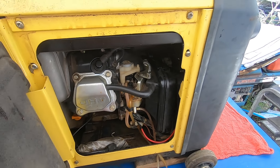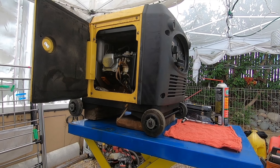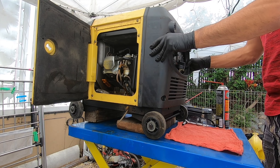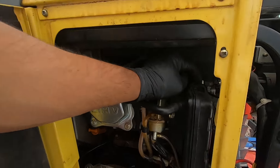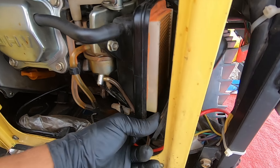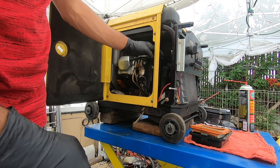What I'm gonna show you guys today is how to remove this carburetor. First thing you want to do is loosen up the bolts — in this case the handle and the bolts all the way around — so that you can pull this lid. Next we're gonna pull the air box, just pop it like that and it should come off the bottom as well.